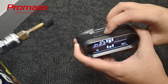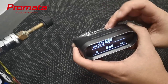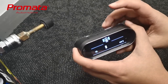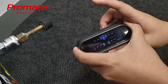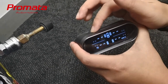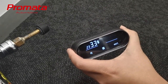Now temporarily confirm that by pressing the middle button once and you can pair another sensor if you like, using the right button to choose another position, or if you want to exit you can simply hold down the middle button until you exit with two beeps. To check if you successfully paired the sensor, press the left button once or twice to go to the spare tire and you have successfully paired that sensor.